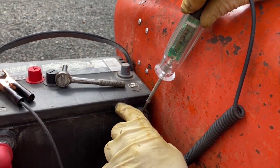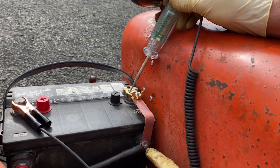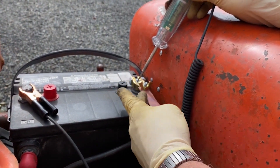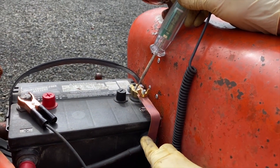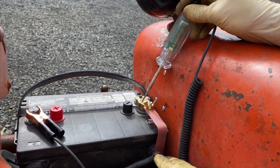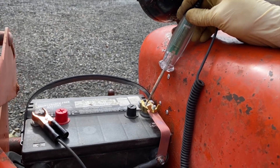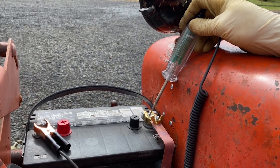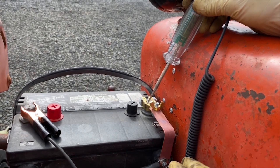Let's verify my theory. What I've done here is installed a strap on the outside of this battery, because I believe that connection is broken inside the battery — which we cannot see. I believe we've found the problem. Let's just see what happens here. Try to start it. Yeah, it starts right up. That's verification that it is broken inside.